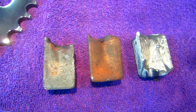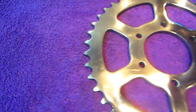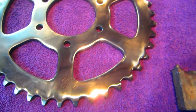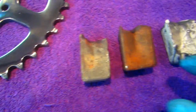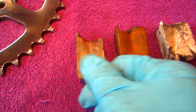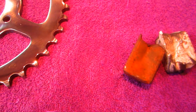I thought I'd take a break here. I'm about halfway through this part with the black, and I want to just show what happens. The black still leaves scratches. It doesn't really come up as highly polished as the red will, but when I'm done with the black, I'll rake the wheel. Just hold the screwdriver, get rid of as much as you can. I'll drop it on the floor.